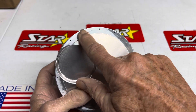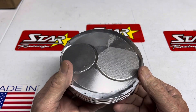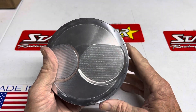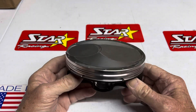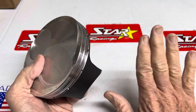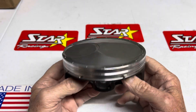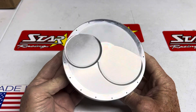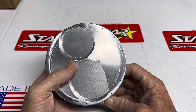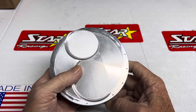People say these clog up. Well, I've never had one clog up. I don't build or design gas-ported pistons to give to grandma or granddad to put around at 2,000–3,000 RPM. I give them to guys that go for wide-open throttle every now and then — it's an Italian tune-up. It really keeps these gas ports clean, and I blow them out. And if they do clog up, it'll be normal — like not having them. So that's important.